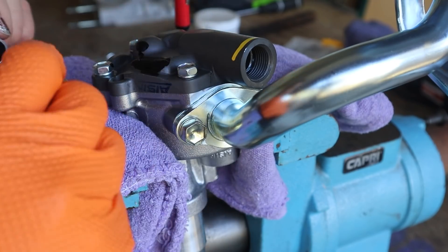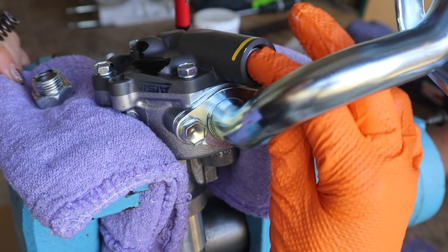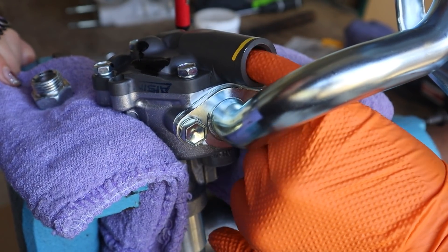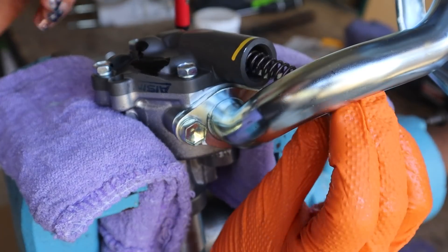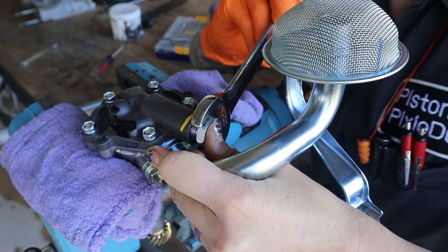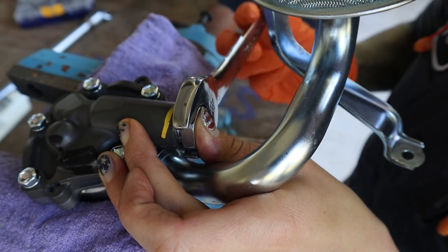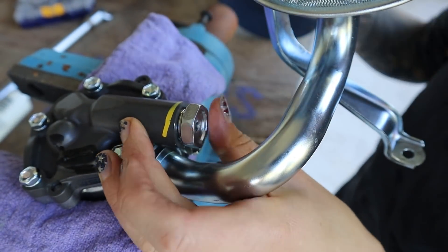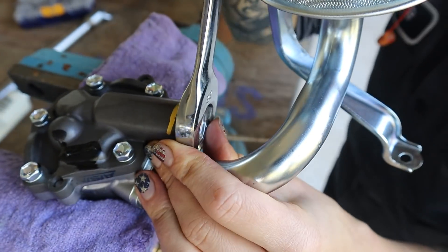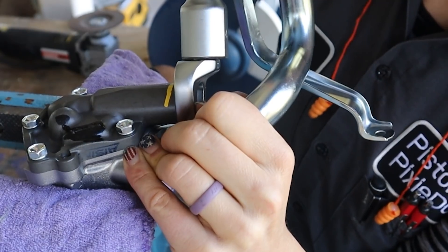I do not condone reusing an oil pump — it's just barely over $100. Now that the plunger is coated in engine assembly grease, I'll go ahead and put it in there and make sure it slides in nicely. I'm going to apply a little pressure while I tighten this — the spring has to sit in the middle of the plunger — pushing in while I turn to make sure I get it started without messing up the threads. Whether you're shimming or using the upgraded spring, you're going to have to force it in. Torque this to 27 foot-pounds.